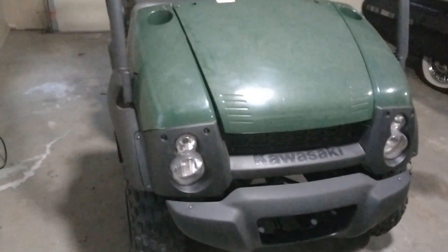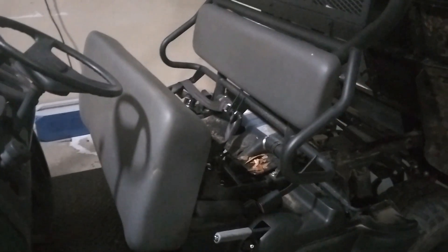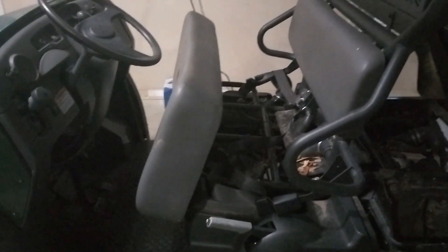What's up YouTube? My name is Caden and you're watching Gas at Garage. Today we're going to be working on this Kawasaki Mule 600 right here. It's been having some carburetor issues — it will start and run, but as soon as you take your foot off the gas it dies, which is telling me that this thing probably has some sort of idling issue and possibly a dirty carburetor.